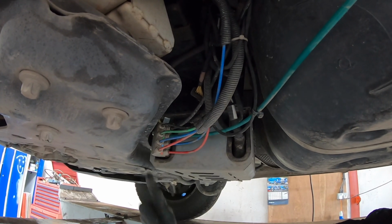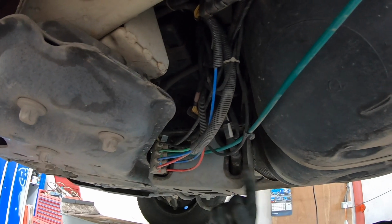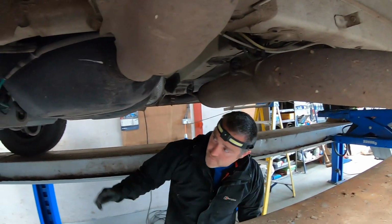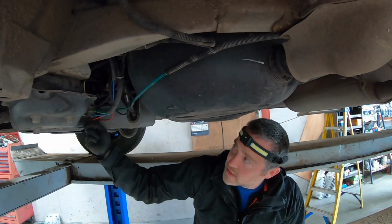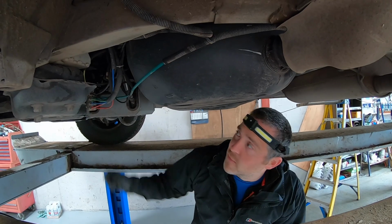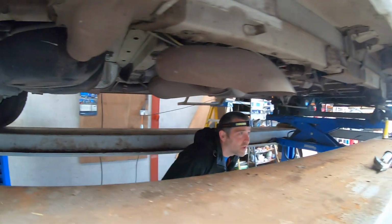We've got the emergency valves up top, which makes it a lot easier to work on. Obviously, I will say though, do not work on this system unless you know what you're doing. Because the vehicle is fully suspended on air, so if you work on something, the vehicle's not supported, and if an airline breaks or something like that, then it will just dump the vehicle down onto its bump stops. So do not work on these unless you know what you're doing.